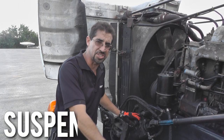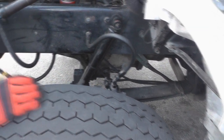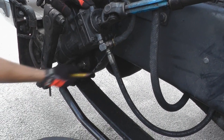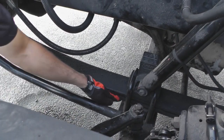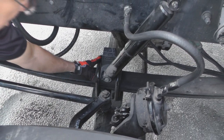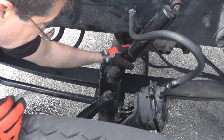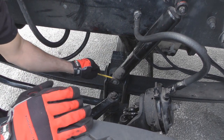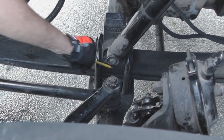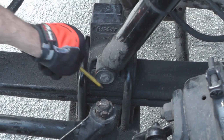The next system we're going to work on is our suspension system. I'm going to talk about the spring mounts on the front and rear of the front suspension — making sure they're not cracked, properly secured and bolted, with no missing or broken bolts. We want to make sure the springs are not broken and not shifted. We're going to check our U-bolts, making sure they're not broken or loose — you can check by tapping the top of them with a hammer. I'm going to check my shock absorber, making sure it's properly secured and not leaking, and checking the bushings are in good condition. We should also note that the center bolt is not broken — if the springs were shifted, that would indicate the center bolt is broken.